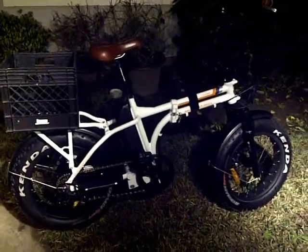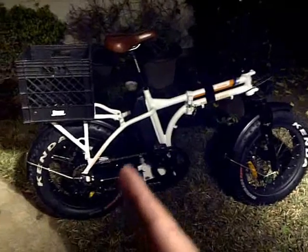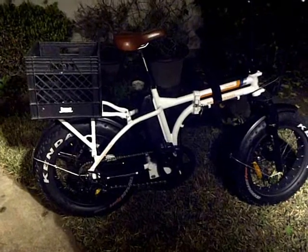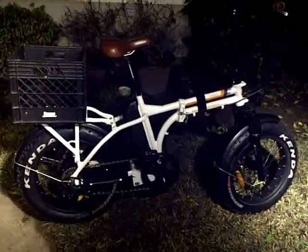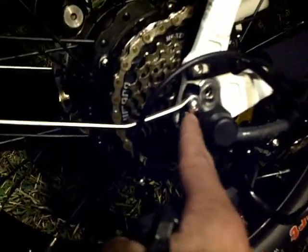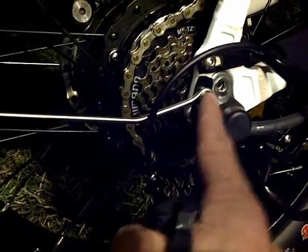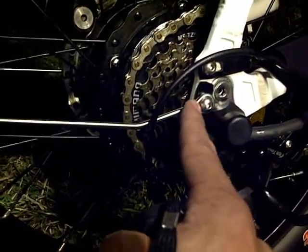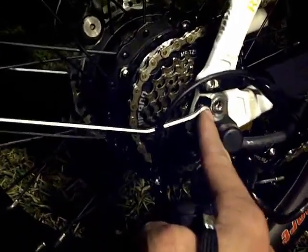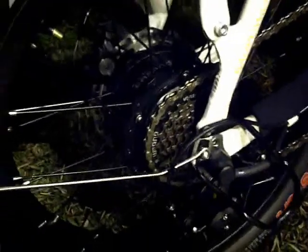And I'm glad I cleaned it today, because I don't think I can get underneath those spots, at least back here. But it was a little challenging. The screws, the bolts. Remember, don't reuse this bolt right here that's on the derailleur. It's too small to have this and the derailleur, so you have to use the new bolt. Take this bolt and use it right here for this one, and then I think everything else is good to go.